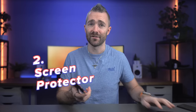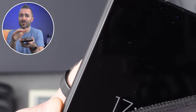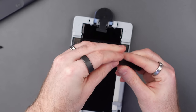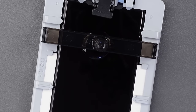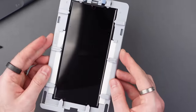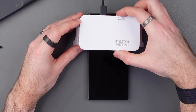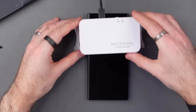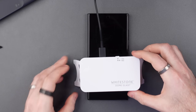Now, once you have got your case, you're probably gonna want to protect the screen on your phone. The Samsung S23 Ultra does seem to suffer from an issue with lots of micro scratches on the screen, which is a little bit disappointing. I'm using the Dome Glass screen protector for the S23 Ultra, which I got from Amazon. This does take a little bit of time to fit, because the Dome Glass actually uses glue to stick the screen protector to the screen itself, and you then use a USB-powered UV light to cure the glue once it's stuck down. It looks a little bit complicated, but honestly, the results you get are so, so good.